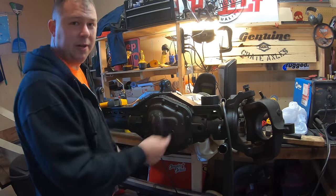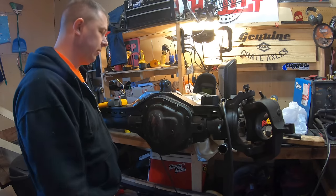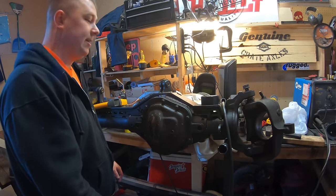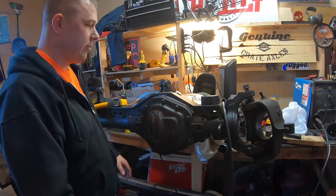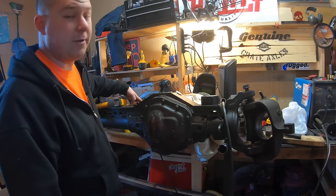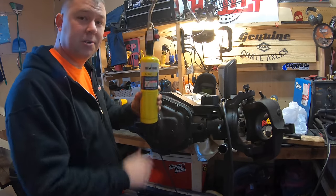I did a really big weld here, but on most diffs you don't have to do all that. A little three-inch weld up here, three-inch weld down there, and over here would be more than enough — but I was in the groove and just welded it all up. I'll probably do the same down this side and weld the tube to the casting, because on the Super Duty we had to cut that back and took off two plug welds that hold the tubes inside the diff, so I really want to weld that back. If the weld cracks, you'll hear that ding — you can grind it down, weld it again, and try the process again. I'd also recommend having an extra can of map gas, just in case you run out during post-heat treatment.